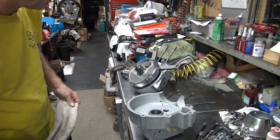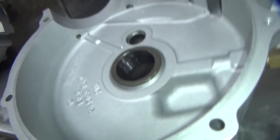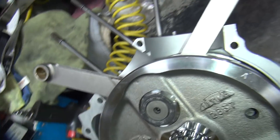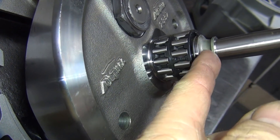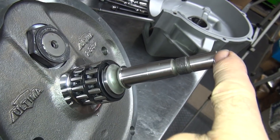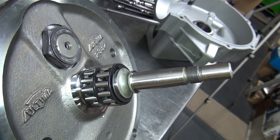All wiped off. I looked at the bearing sticking out further than it should, and I don't really see any reason for it to be made that way. I think the case race is a little bit shorter than what it should be — that's the only thing I can think of. They got the normal thick spacer built right in there, and the length of the shaft should all be the same. This is the stock crank dimension; it's made for the '93 and later snout, so it sticks out further here. But that doesn't matter if it sticks out more in the earlier cover.